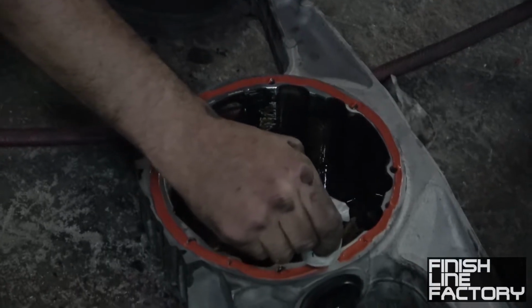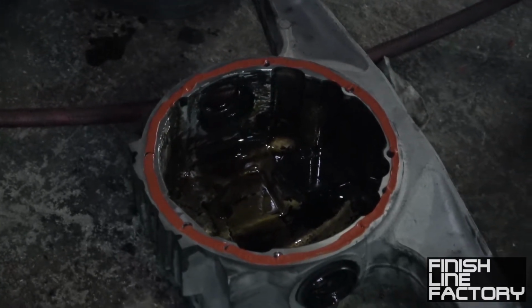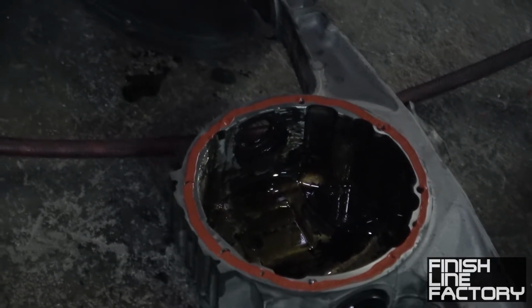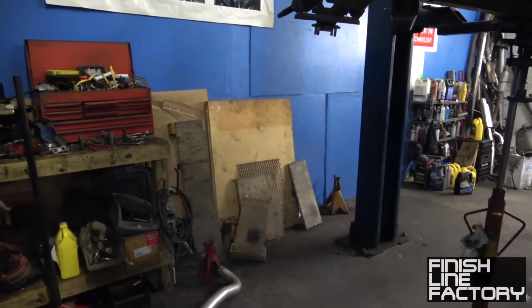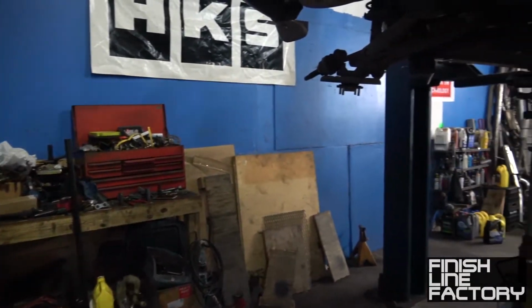Here we've got Esty expertly laying down a perfect bead of silicone. That's my first one? That's actually really good. You know why? Because you did it. Did you give it like 5 or 10 minutes? Because you're making a gasket. You don't just stick them together. You're supposed to let it get a little tacky first and then stick them together. That actually came out really good.